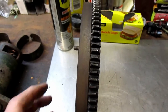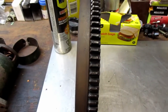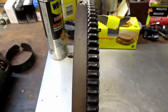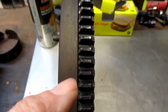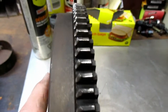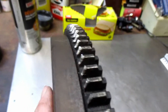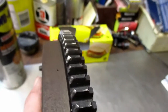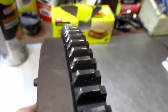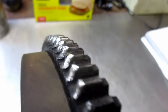Now when I first had a look at the flywheel, it looked to be in good shape with no real apparent damage, but then I got looking closer — especially after looking at that one starter motor — and the teeth, for the most part, look to be in pretty good shape. You can see here they're nice and not really worn at all, but then we come over to here and you can see right in here where the teeth have been pretty badly gouged up. Then we've got another few teeth that are okay, and then some more here that have had some chips and meat taken out of them. All the way around here, I think this is the worst spot right there.